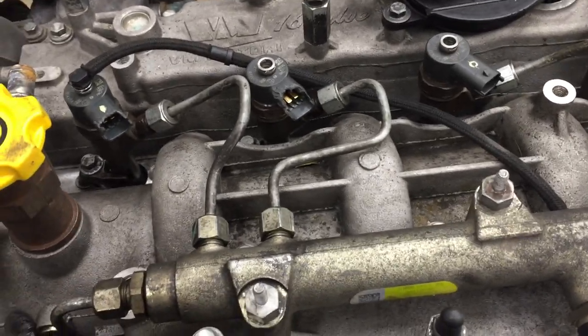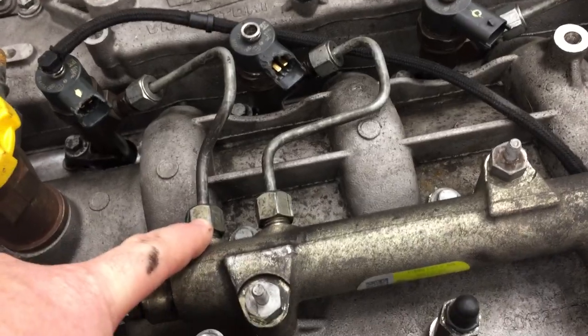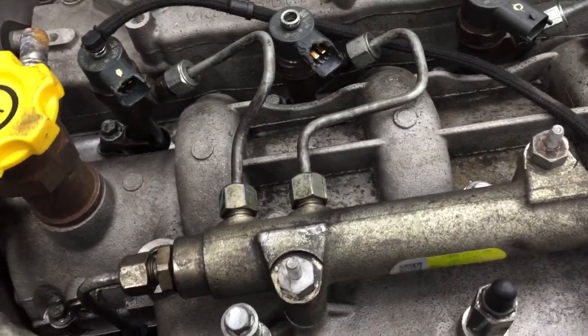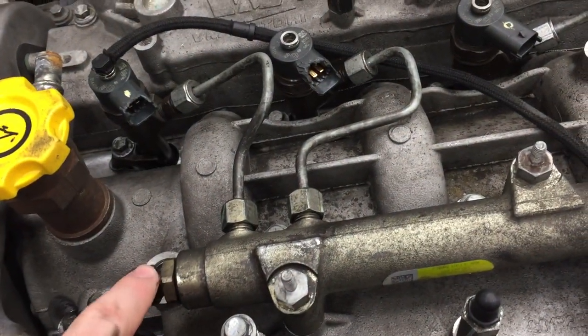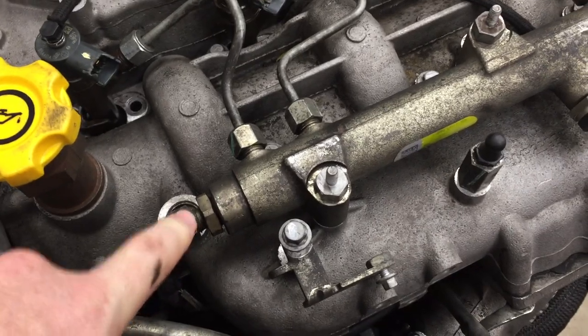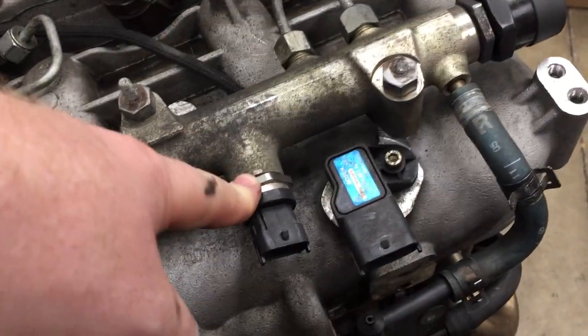If you're trying to diagnose the injection pump, you can unscrew this high pressure line — you might have to pop off the couple of bolts that hold the fuel rail down to move it out of the way. You can crack this loose and see some fuel dribble out. If you have a helper that can hit the starter and you watch here, you'll see fuel start dribbling out. It's not a ton, it doesn't shoot out in big spurts, but a fair bit of fuel will pump out if the system is properly bled and fuel is getting up there. If you've got a fair bit of fuel coming out while cranking, you're probably getting enough fuel up to the rail, and you might have an issue with the pressure regulator or the pressure sensor.